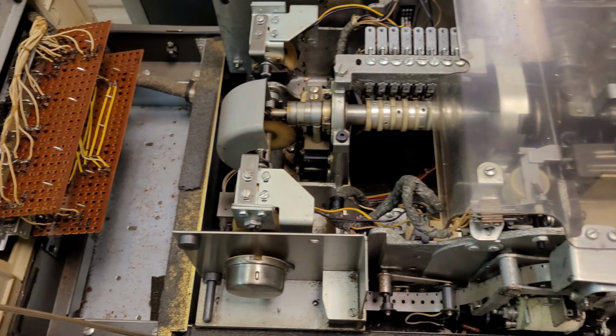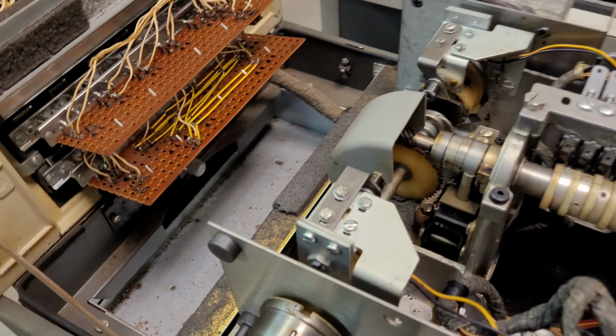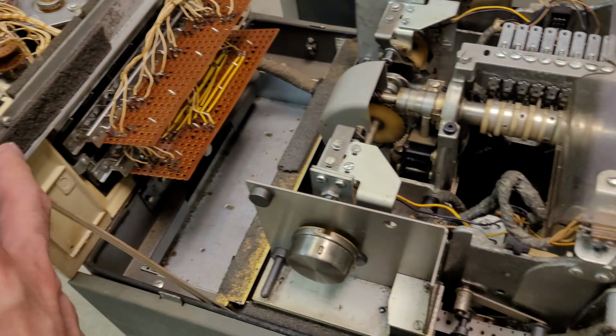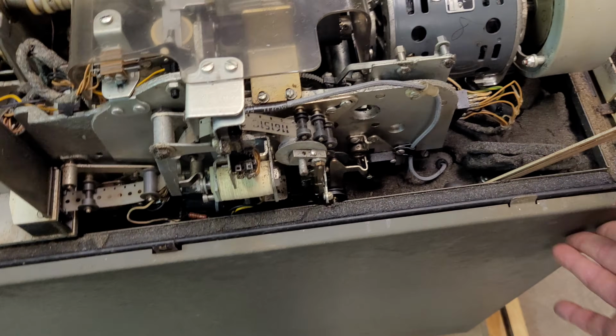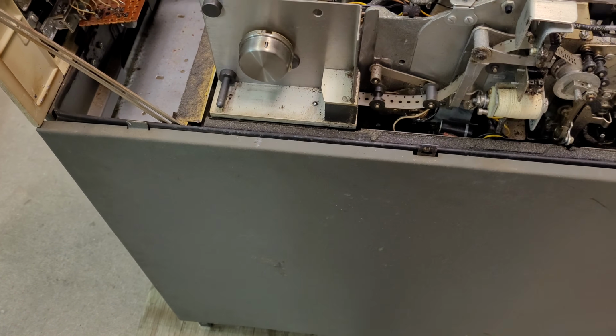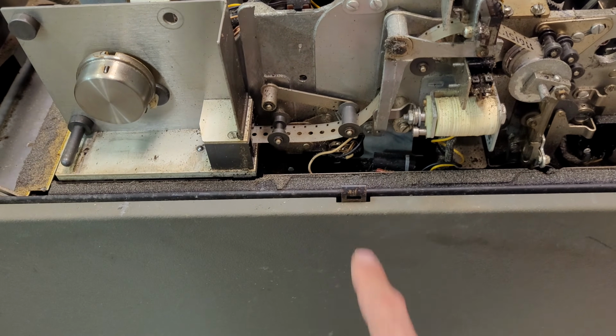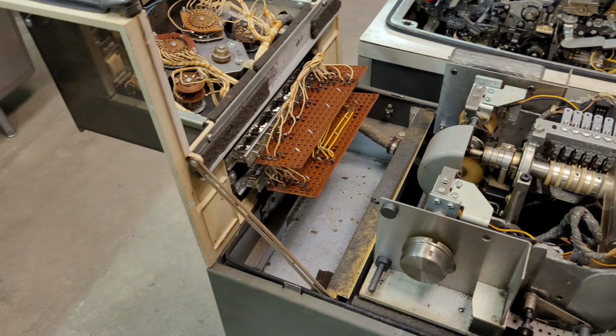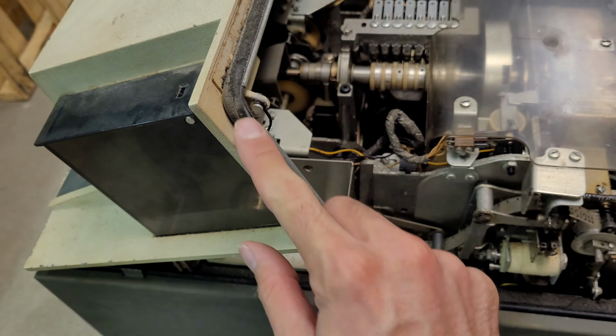Yeah, it's a pretty interesting unit. Definitely a lot going on. Looks like there's a thumb screw that holds on the front panel. Once you lift both these tops off, that's the proper way to remove the side panels. They were already loose when I took this apart, so somebody else before me managed to open it improperly. And there's the little lock. To get inside this unit, you push this tab in with something nice and flat, then lift up the back cover, and that releases the front cover, since the back cover goes down over this little gasket.